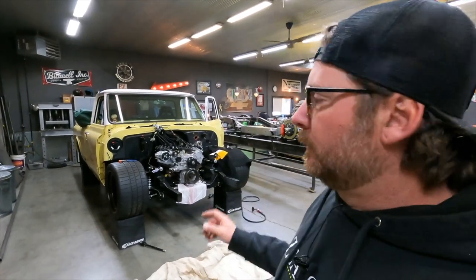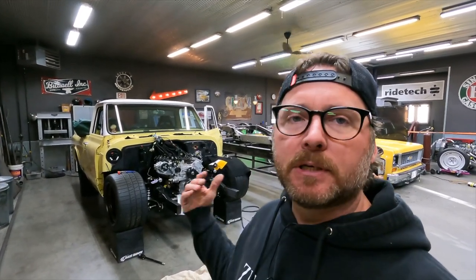So this truck is on one of the new Apex Predator chassis from Brian Finch. So we're kind of excited to be a part of the project with Corey and putting the truck back together. In Corey's home garage, he had already got the cab on it, and they had worked through 90% of mounting the bed to that chassis. We had to do some other little tweaks, fabricate some brackets to get the bed mounted, and now we're working on steering shaft, exhaust, brake plumbing, fuel plumbing, a lot of the stuff that chassis didn't come with. So just tying that up.